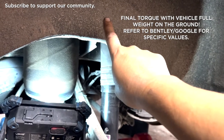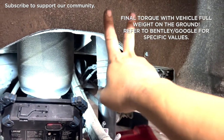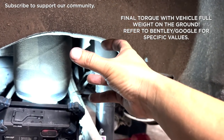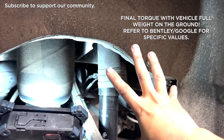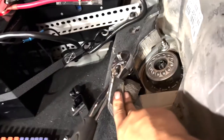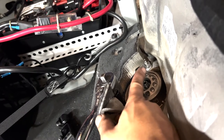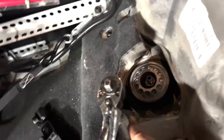And then I got one of the holes in, I think it was the inside hole. Once the inside hole was in, the outside holes were almost in, and so I jacked it up a little bit more, not too tight, and I wiggled it until it plunked in there. I had to go back and forth inside and out just to see what the hell was going on visually. And then I put the 16 millimeter bolt there, and once it did that, I started tightening that bolt, and then this went through enough so that I could put the bolts on here. And now this is what it looks like, the new piece.